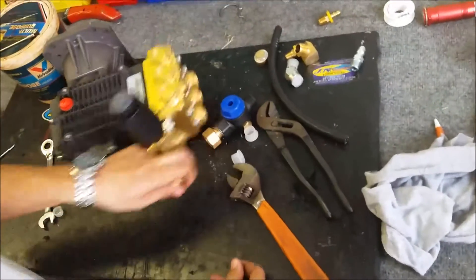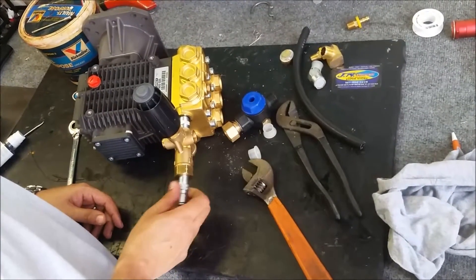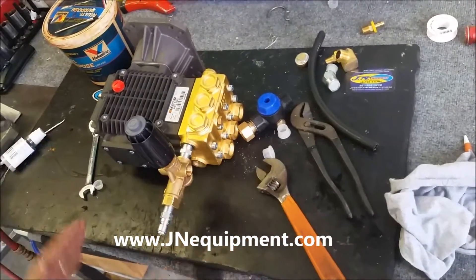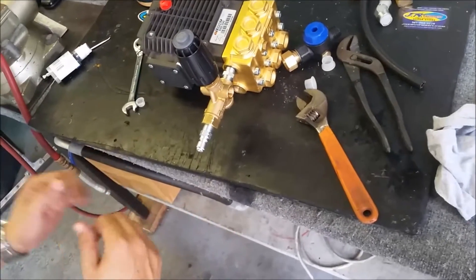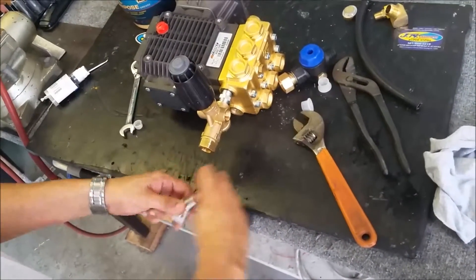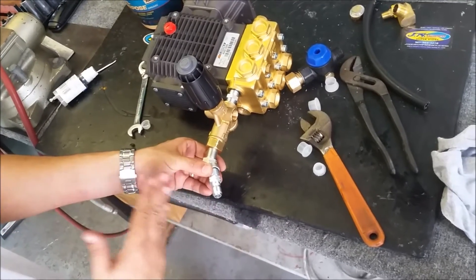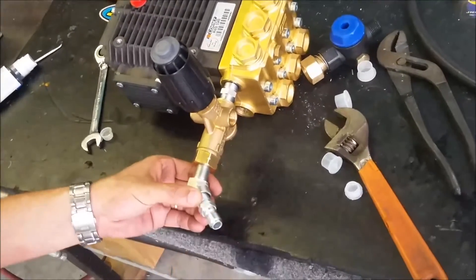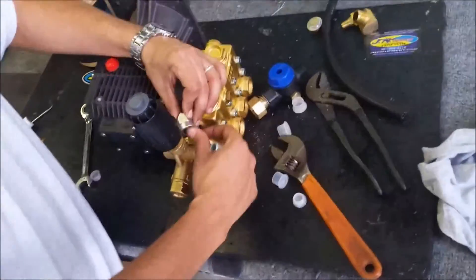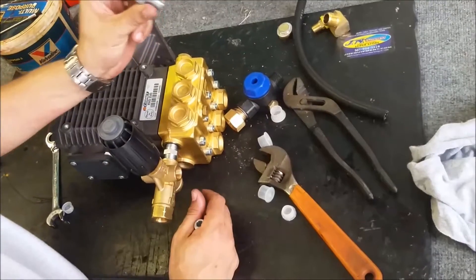So I got that part on there — pretty straightforward. I'm going to finish that off by putting my plug here. On some units when you actually have this on an engine and on the frame, your frame comes up right in this area and you could run into a problem where you can't fit your hose here because of the frame. That's where this elbow comes in. If I were to need it, I would install this here so it comes to the side and my frame would probably be right in this area. It's not always necessary, but some frames need it, some don't. You could also install it here, turning it 45 degrees right at that spot.